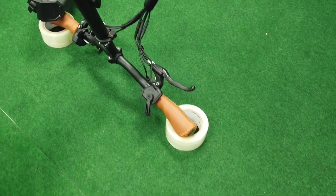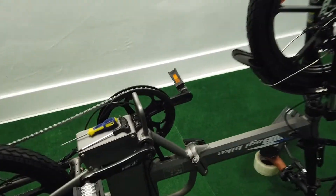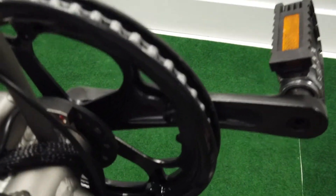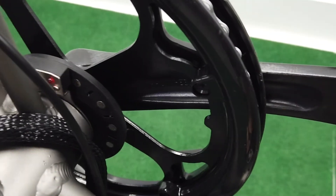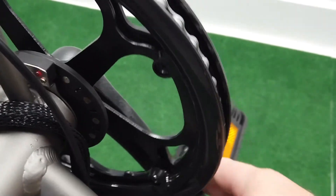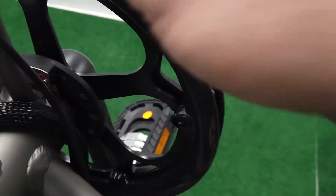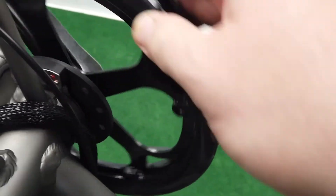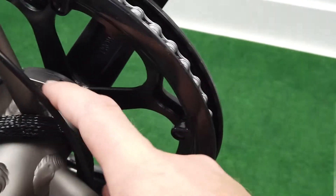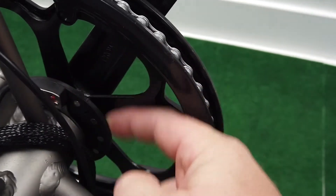Just throw some spacers there so you don't squish your screen. The pedal assist sensor we're changing today requires those two tools there. It's down here — this should be the same on just about every electric bike that has the magnetic cadence sensor. There's a disc here that spins with your pedals and a sensor that measures when the magnets go by, which activates your pedal assist. Sometimes it's just out of alignment — you want it nice and upright with this circle really close to the sensor.